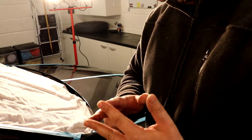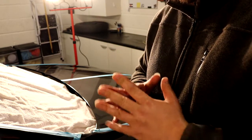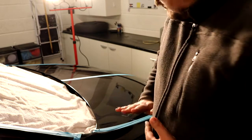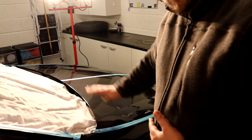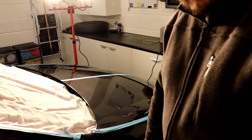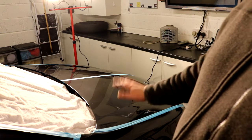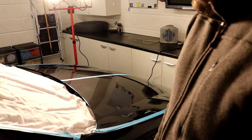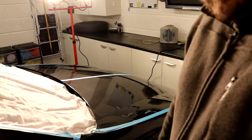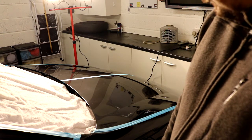We also, because it was our first ever run, we used four dollops to prime the pad. Now we're going to be using three that the pad's primed. Once you've laid your film of product out at speed one, you then ramp up your speed. And I was doing it about four there, which is, normally I'll go a bit faster, but like I say, I thought this clear coat would be quite easy to work with, and I can see it is. So that's quite a sensible speed, so I'll probably stay near that speed.